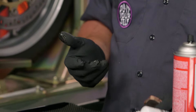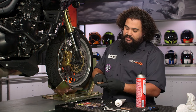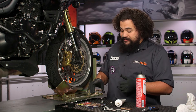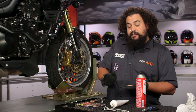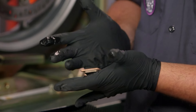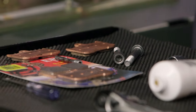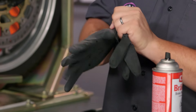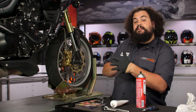Now the other place I like to lube too, and this might sound a little crazy, is actually the backs of the pads. I'm going to put a little dollop on there. The reason is we're putting lubricant basically anywhere metal is moving against each other — the pistons themselves hit the backs of the pads. A lot of times when people have brake noise they can't figure out, it's not actually the lining material hitting the rotors making noise. Sometimes it's actually the backing plates making contact and sort of singing with respect to the caliper piston. So I'm going to throw a very, very thin layer on there — I like to liken it to buttering your toast in the morning. Be sure to change gloves frequently and don't get that lube all over the place — there are only a few select spots we want to see lubricant.